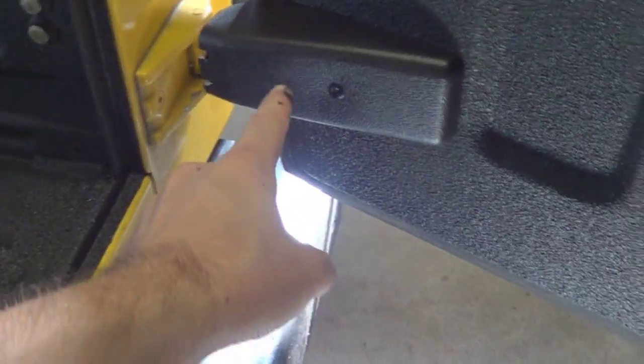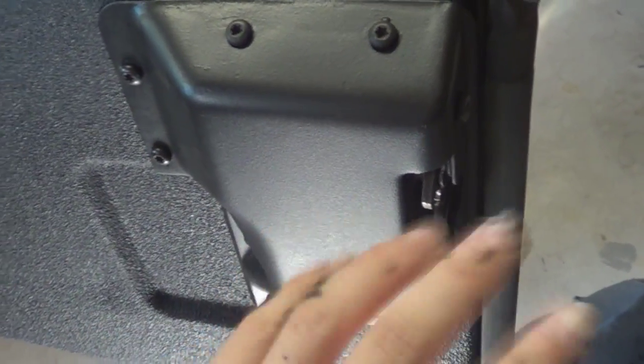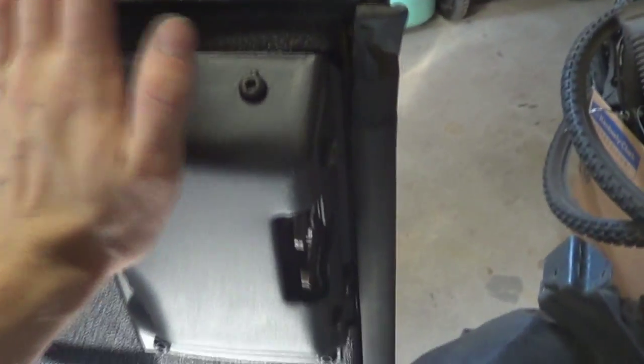I put this back on — it looked good. I painted the screws for this. It had actually worn down a bit; I POR-15'd it and plastic-dipped it, and it looked good. I gave it a bunch more plastic dip coats. The thing with plastic dip I found is if you're going to use it on something with any wear, just do a lot of coats — five, six, seven, eight thin coats over and over. It really works out best, and I think it's going to hold up a lot better now.